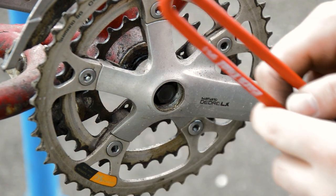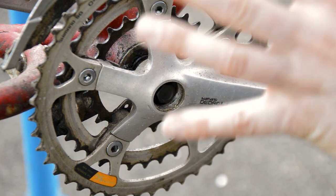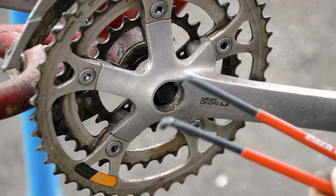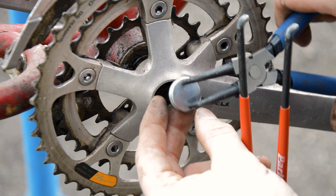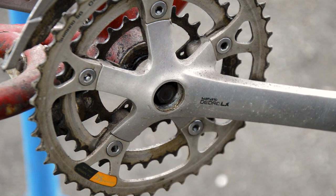You can, of course, try and budge it with a screwdriver. It sort of works, but you'll ruin the holes on those. So try and get something suitable. Maybe even a set of circlip pliers goes in there and just unwind them. Something that doesn't damage the holes.